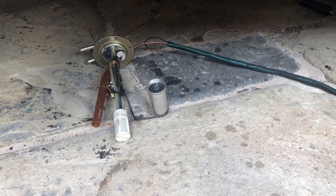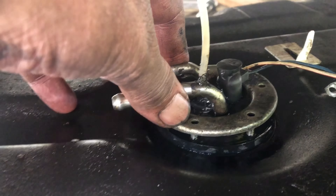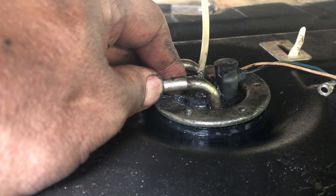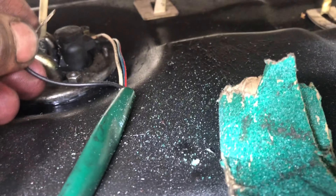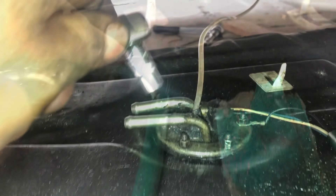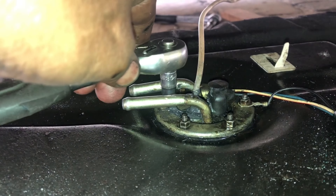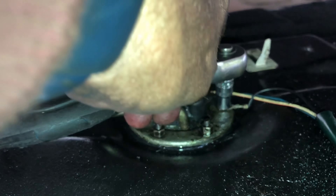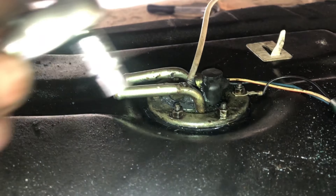If putting it back together is the opposite of taking it apart, I think it's time we started. We get the sender unit on and push it down — there's the spring of the fuel filter to overcome. I did use JB Quick Weld as the other stuff takes at least a couple of days to cure. I've also taken the opportunity to buff up the earth connection with some sandpaper prior to refitting. All the bolts are nipped up — I don't use too much force as they're only tiny. I'd torque them to perhaps 5 newton metres but I don't have my torque wrench on this job. You can feel where they nip up as it compresses the tank seal down.